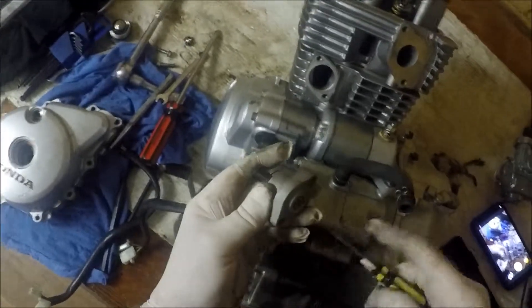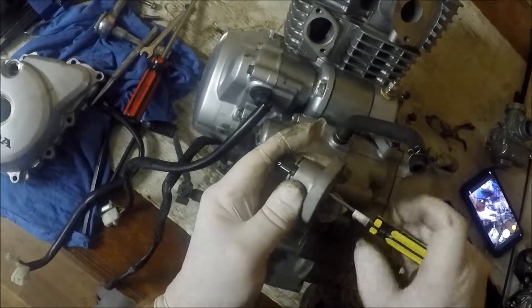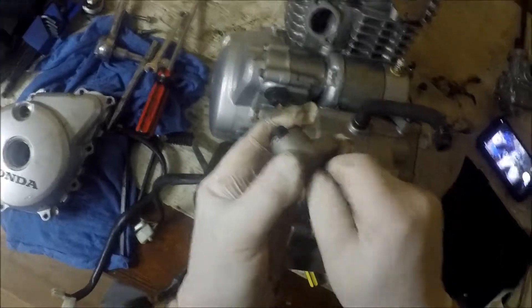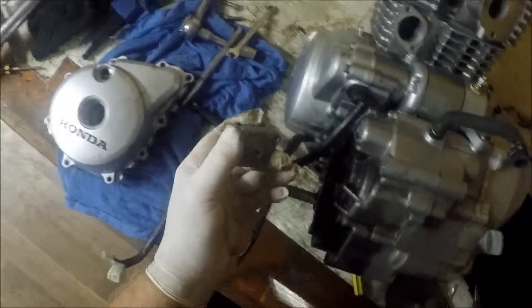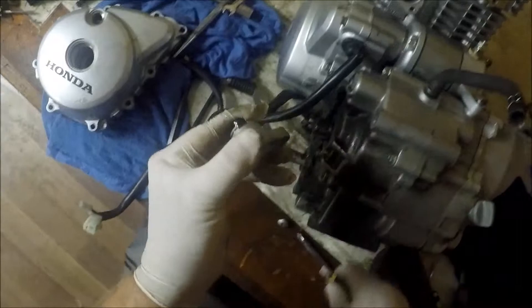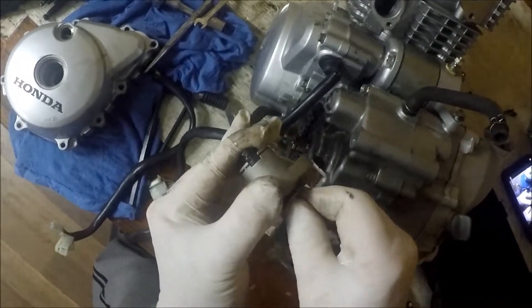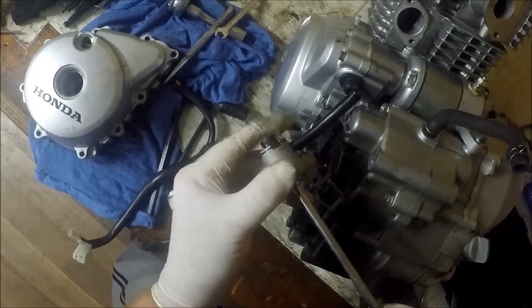As you can see, that is not going to go back. So just put your flat blade in there and fill the slot. Wind it back as far as it will go, and get that locking bolt and put it back in, then tighten it up. If you don't keep it wound right back — you've got to put it right back, as far back as it will go — and don't let it move one millimetre. Lock it down, and there we go. Success.